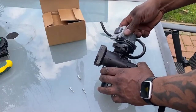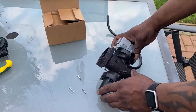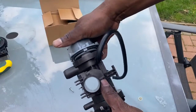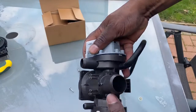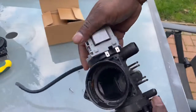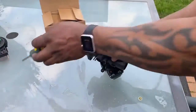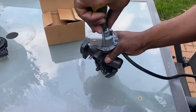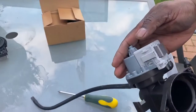It's just a matter of fitting the unit in correctly and the right way around so I can put the connectors on. It's got a seal around it so you've got to squeeze it in and make sure the seal is pushed in correctly. It's got a black seal ring going around the side — once you've got the right position, it's just a matter of pushing it home all the way around. Now that it's seated, put the three screws back in. And that's it — fully assembled with the new drainage pump.